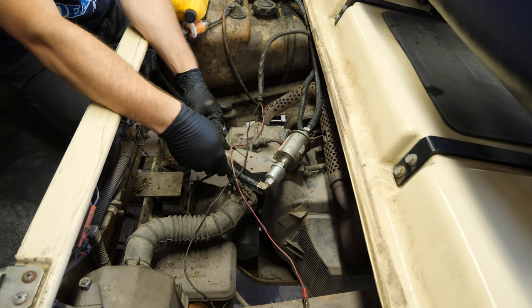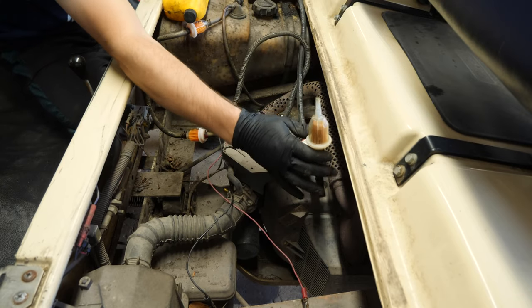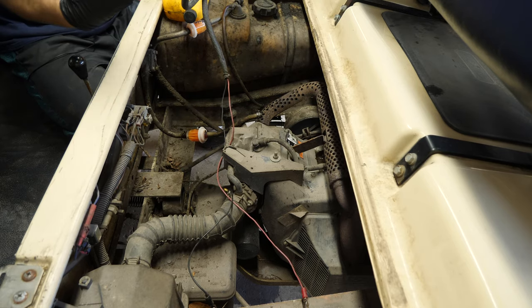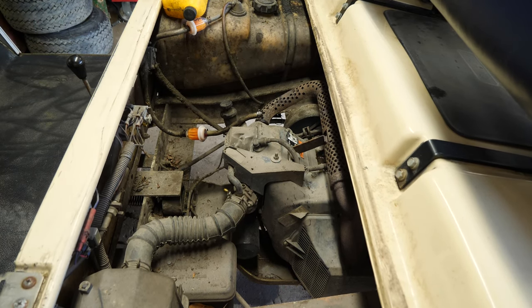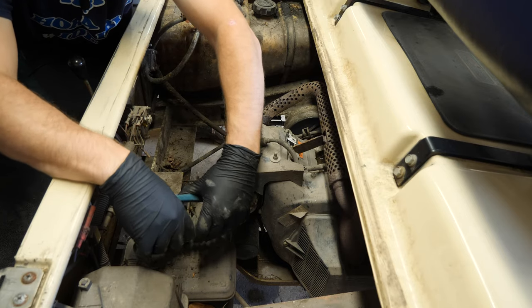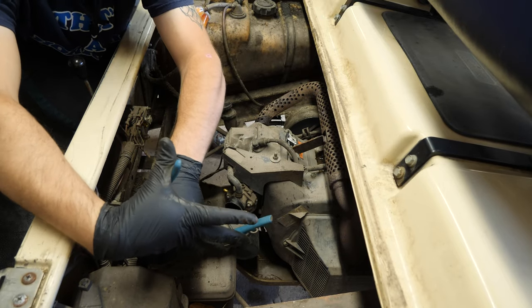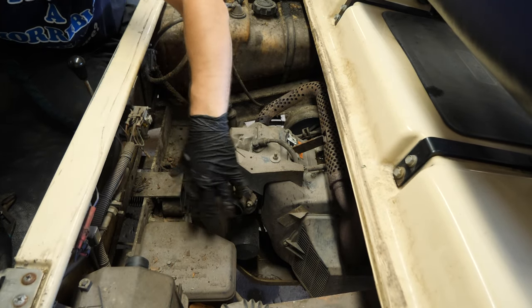I'm going to disconnect this. I just think there's some gunk in the carb. A lot of times there's a little bit of moisture that builds up because of the ethanol in the gasoline. It sometimes happens over winter and it's very common — really hard to eliminate that problem. It's always going to be there because of the ethanol in the fuel. We're going to shut the tank off so it can't dribble anymore, and I'm going to take this airbox clamp off to get it out of the way.